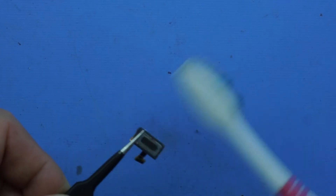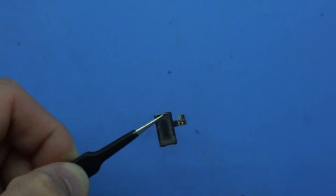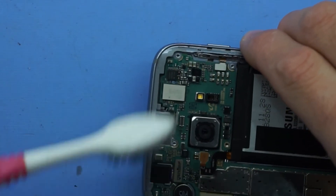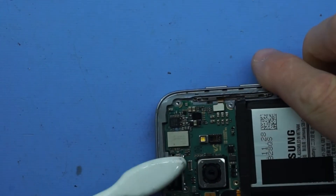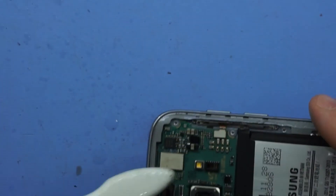Typically, if you experience any audio issues with an earpiece speaker, or any speakers for that matter — especially small ones like this — they're more prone to failure due to just dirt, dust, metal shavings, sand, any kind of substance that can get in there. You could try washing it from the outside of the phone, but all that's going to do is move it around inside. And since it's a relatively sealed unit, you're not really going to be able to clear that speaker. The reason I clean the grill as well is because if you look through a speaker grill and you can't see much light come through, that's going to stop sound travelling out. So as long as the speaker and the mesh grill are clean, you should be getting decent, factory-quality audio from your device.